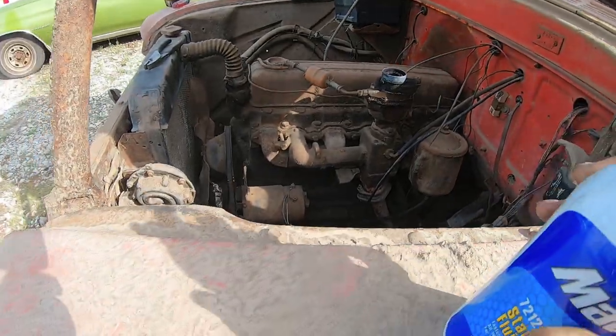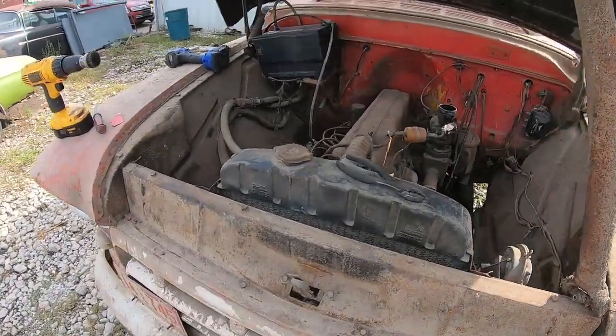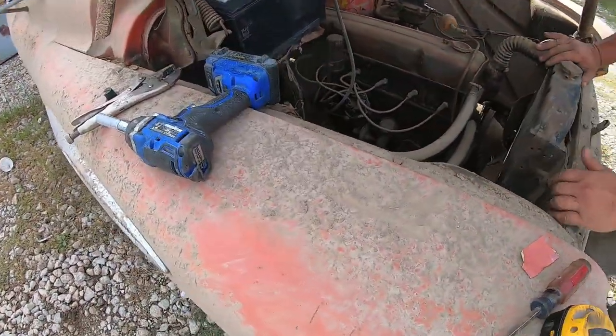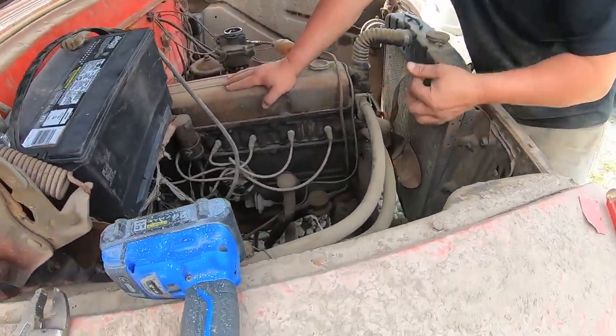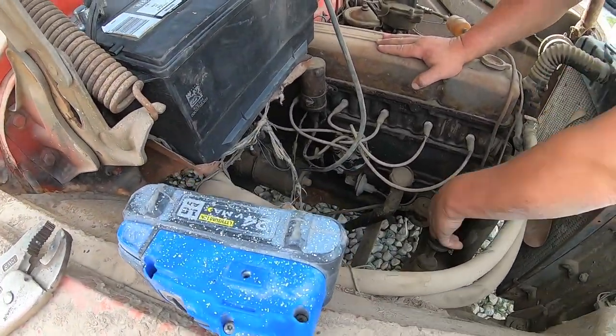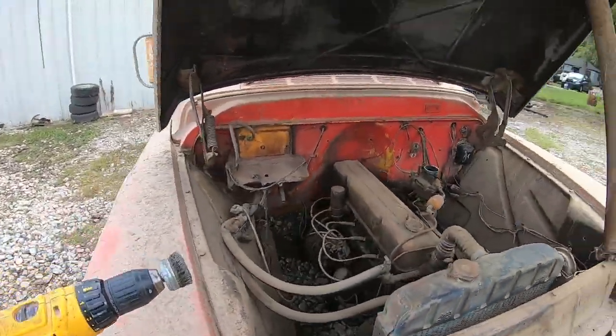Good. We know it's gonna go. Yeah, and then I think our fuel pickup is probably clogged like the C10 was, because we ain't got nothing. Well, or there's nothing in the tank. I think there's some in the tank, because you pulled that thing out and there's crap all over it. Right, but it could have been laying in the bottom of what's left, and if it's got that pickup tube that goes down in through the back. All right, so as you can see, we got this thing popping over, but...